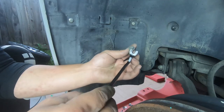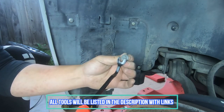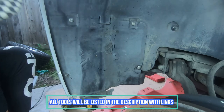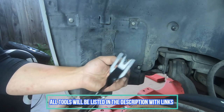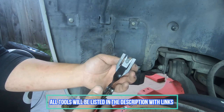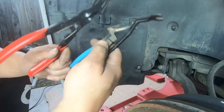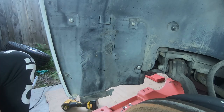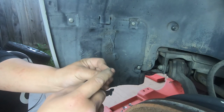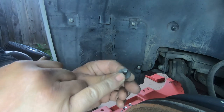I use a few different tools. I have a tool called a trim removal tool so that you can get under it like so and then pry it out. That will allow you to eventually remove the clip. I also have another trim removal tool — this one works where you get under it and then it uses the car as a pressure point. And then once you click it, as you can see it pulls it right off. These tools come in very handy when removing push clips because some of them can be very annoying to remove. If you use just a flat head, they can get brittle due to heat and sometimes when you pry it, you will break it.